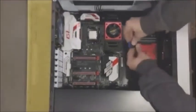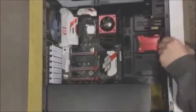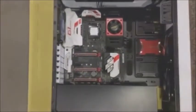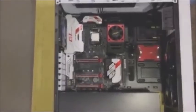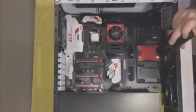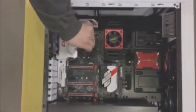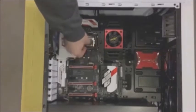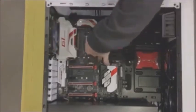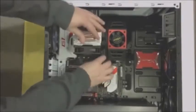This is where I put the SSD — the Kingston HyperX Savage in the front. It's 480 gigabytes, has my operating system on it, and it's really quick. The screw pattern perfectly lined up right underneath the optical drives. I could also stick a second SSD right underneath this one. I'm using Arctic Silver 5 for the thermal paste, and a little plastic piece from the RAM container to spread it out. The bottom of the Hyper T2 has heat pipes with canals, so I spread the thermal paste out to get full surface coverage over the CPU. This is the final look over the case.